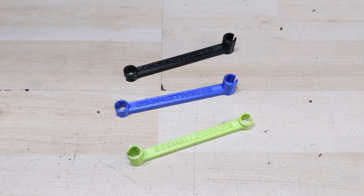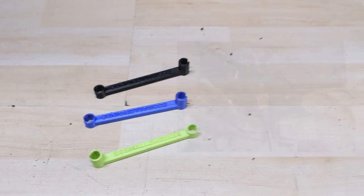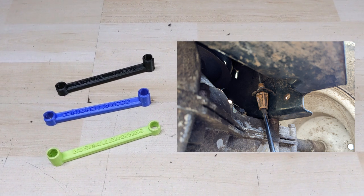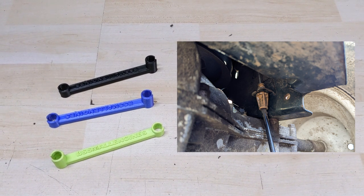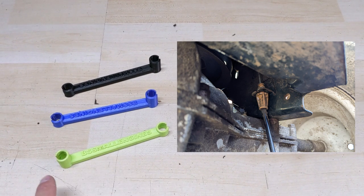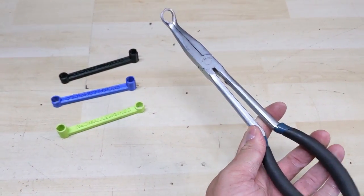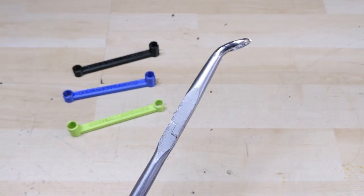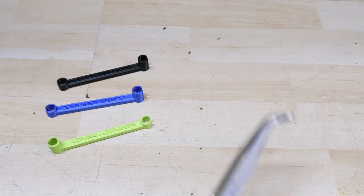What are some drawbacks of something like this? I'm going to put a photo on screen — this is an MTD riding lawnmower where I had to remove a PTO cable, that's the power takeoff or blade engagement cable. On this particular MTD riding lawnmower, the cable snaps in near the rear transmission housing and it's incredibly difficult to get in there. I didn't have enough room to use this tool due to its straight and 90-degree design. I actually had to use fuel line or hose clamp removal pliers — they were rounded enough and had enough offset that I could fish them in there, open the jaws, and close around the tabs just enough to pull out the cable.